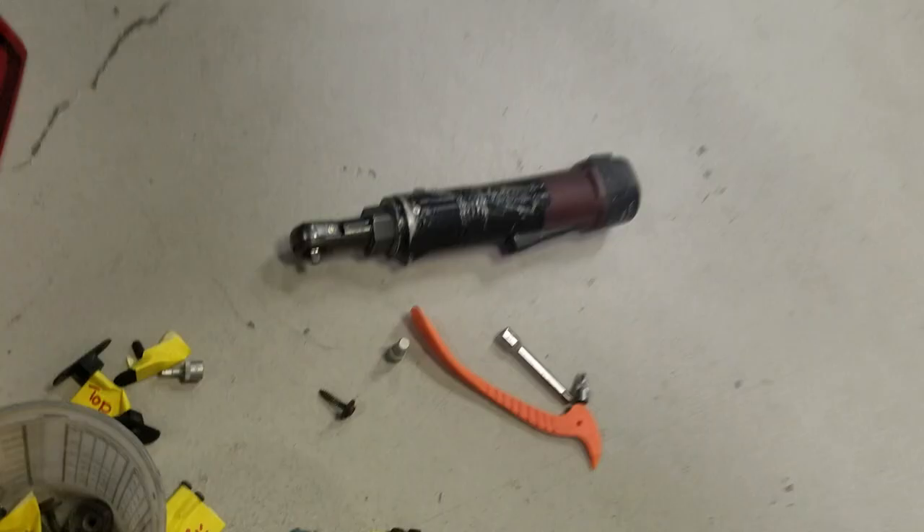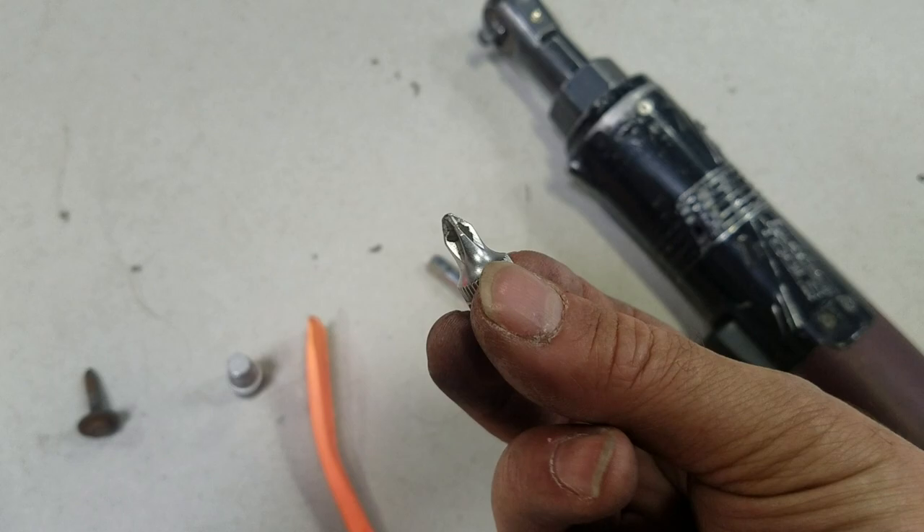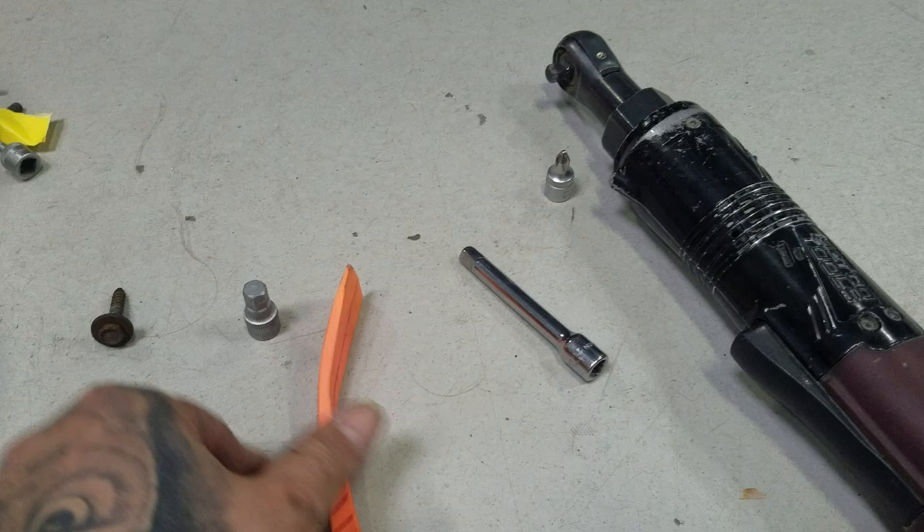Here's all the tools I actually used: electric quarter-inch driver, quarter-inch extension, Phillips for the liner clips and tail light, the four mil and the eight mil socket set, and a plastic pry bar. I used the plastic pry bar because this is a full bumper — I went underneath the quarter panel and pried it down a little bit and the bumper just slides off.